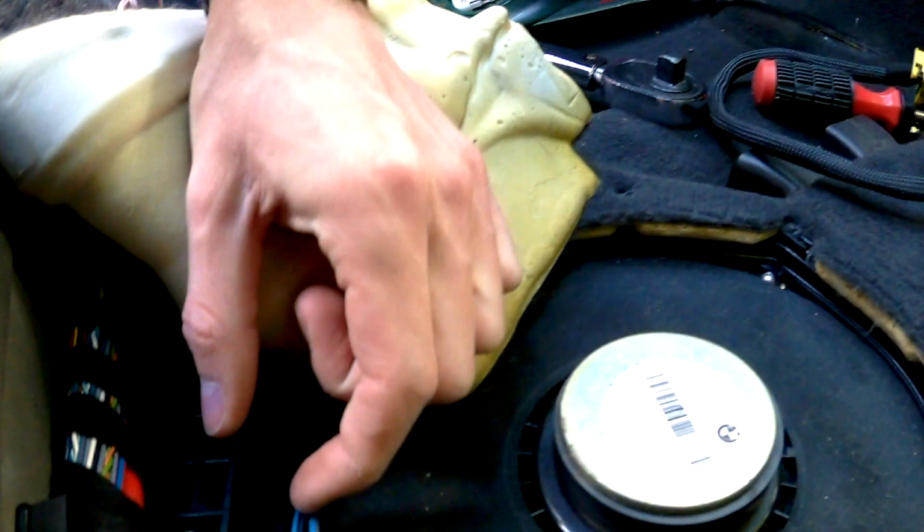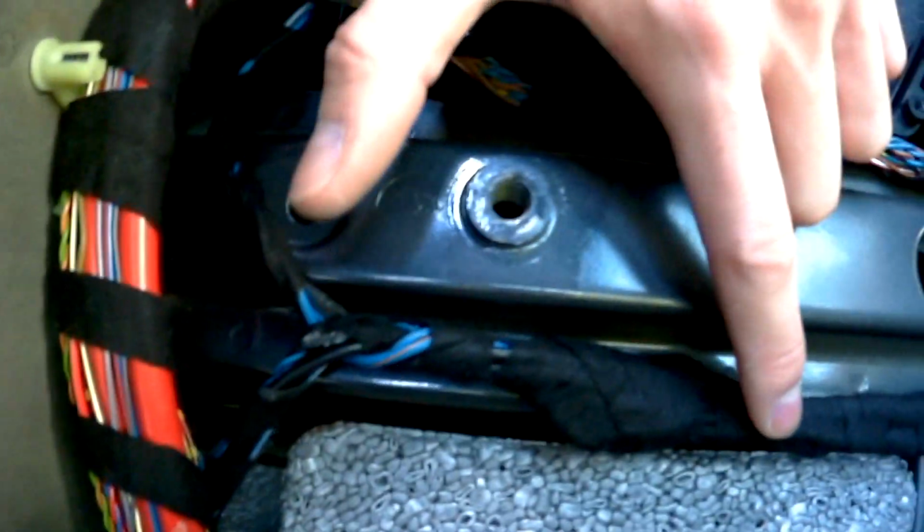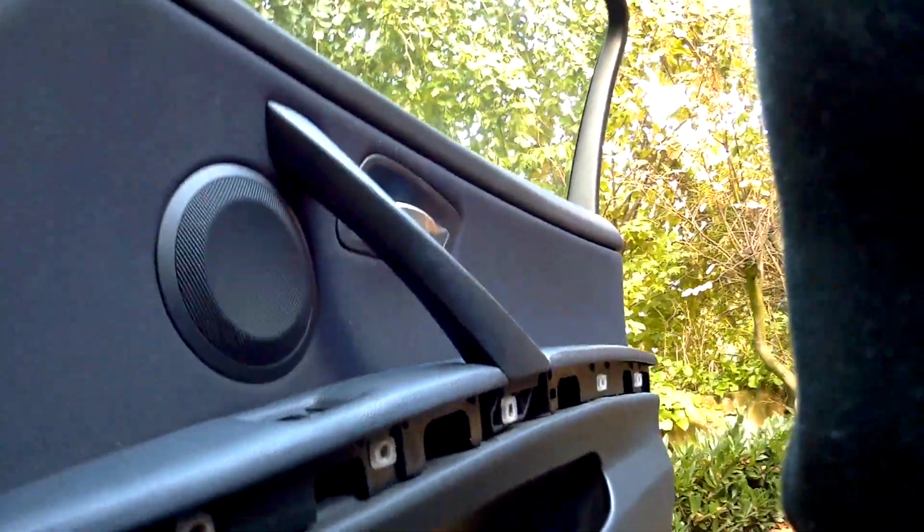These speaker cables are these, as you can see, the easiest here. Speaker cables are these blue things. On the driver's side, I think it's white and brown. Brown is the minus pole, I think mass pole it's called, and the black side on the right side is the plus pole. On the driver's side it's the white cable. So you're trying to look or find the place where it's looking like that. That's where the cables spread from the radio amplifier, coming from here to two cables, one going to the subwoofer, the other one going in the door to the speakers.